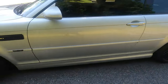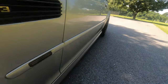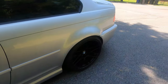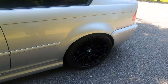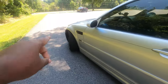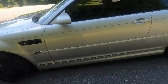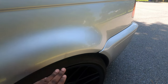Man, this is nice. As you can see, it fits well on the back when you look at the profile. This is just perfect. When I change the tires, I'm going to go with Michelin Pilot Supersport or Pilot Sport 4S. And probably I'm going to get 275-35-19 on the back and 255-35-19 on the front. When I do that, I'll probably have to decrease the spacers because the tire will be farther and might rub again.